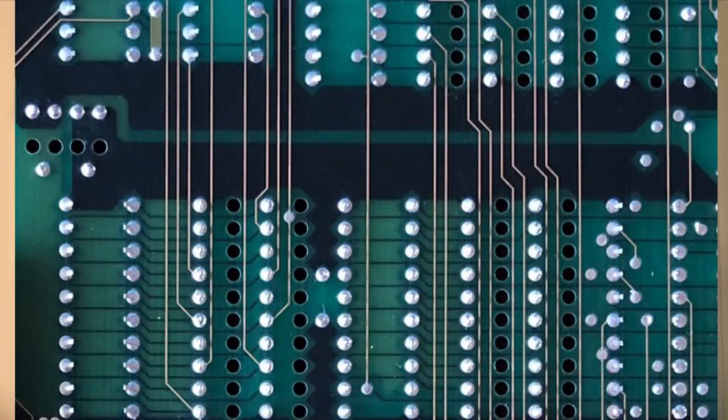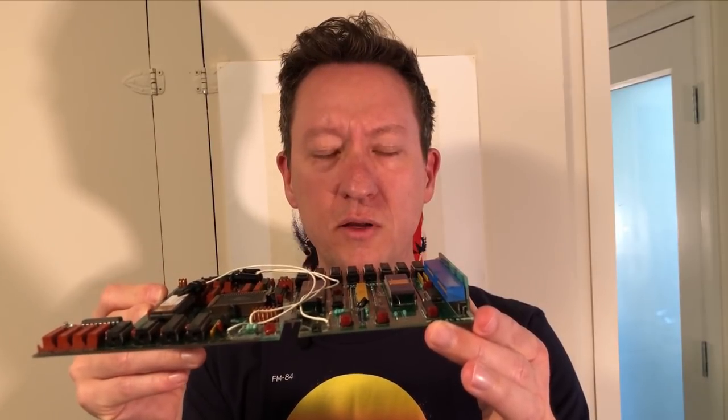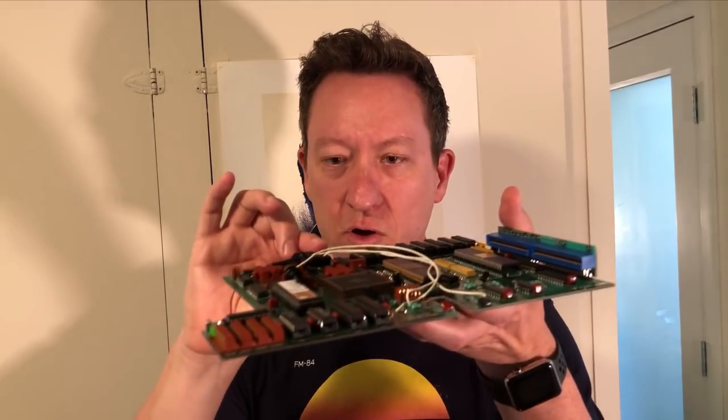It's really easy. With this one, there are no plastic guides at all. You have to literally and magically put this exactly on where all the golden pins were, assuming none of them moved 1/100th of a millimeter, and set this right down on top of it. Now, I've tried for about 2, 2.5 hours, and I've gotten this so close, like maybe 85% of them all the way down, but there's always one row somewhere that isn't, and you can't see what you're doing because it's got to be all the way down to the motherboard. There's a very small gap and you can't see underneath it.